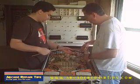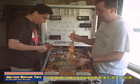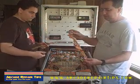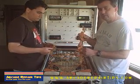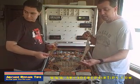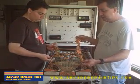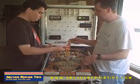Now these plastics are in pretty good shape. They do reproduce a lot of the plastics, but one thing I have seen a lot of times is they will be warped. If you do a little research, it is not really hard - you can actually put these in the oven. I like it on some wax paper at about 300 degrees, and it will take out some of that warping. So cook them for a little bit.